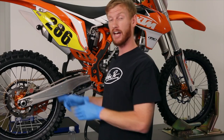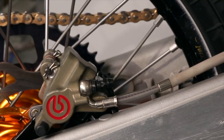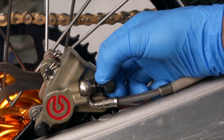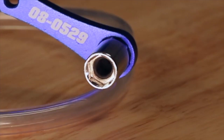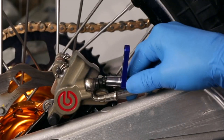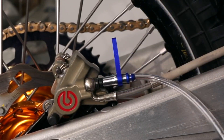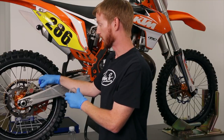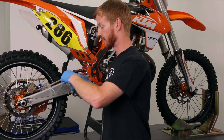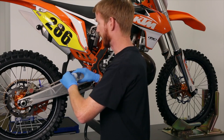In this case the fluid is pretty fresh so I'm just going to top it off with some fresh fluid. Now I'll get the caliper set up with the 8 millimeter mini bleeder. There's usually a rubber protective cover over the bleeder nipple, so remove that, then line up the mini bleeder over the bleeder nipple. There's an integrated rubber seal so you may need to give it a firm push and wiggle until the tool engages the hex on the bleeder. Reposition the wrench to find a good spot with nice leverage, then grab your empty catch bottle, feed the line in place, and find a nice resting spot for it.